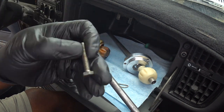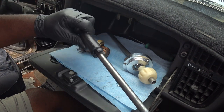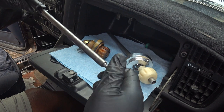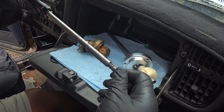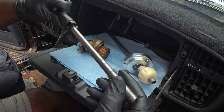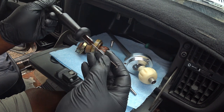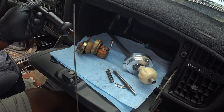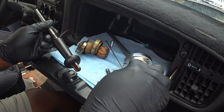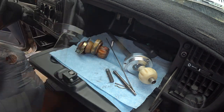First you will want to remove the locking cotter pin and then slide the old swivel ball cup assembly off the shaft. Next, find a suitable object to insert into the top of the reverse lockout collar — in my case I used a suitable size bolt to hold the hook tab still. The reason for this is that the hook tab needs to be held stationary because it is spring loaded. Next, unscrew the lockout pin at the bottom of the assembly — this is attached to the threaded hook tab shaft inside. Once disassembled, you can see the small shaft inside is threaded.